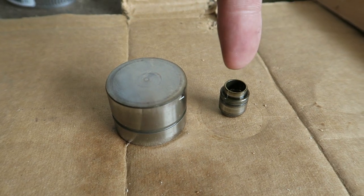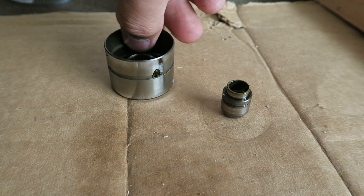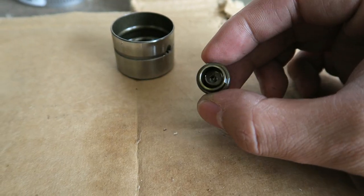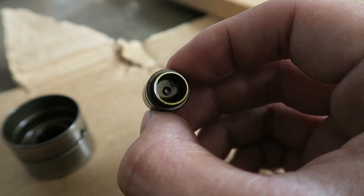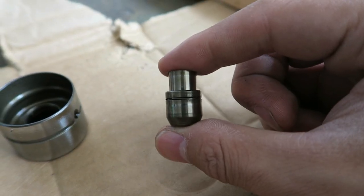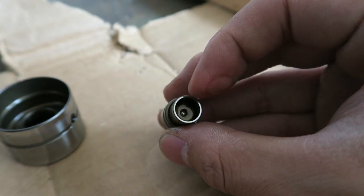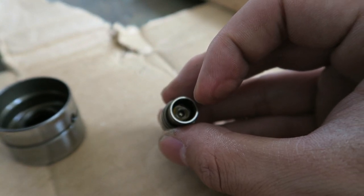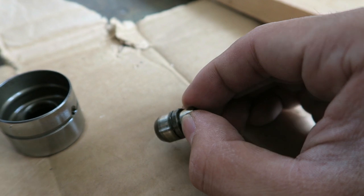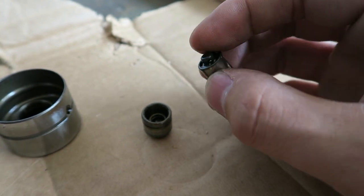Alrighty, so as you can see right there, that is the actual piston inside the lifter. And after I flip this over, now you can see the empty casing. Oil comes in through this passageway, enters out into this channel right here, and then fills this piston right here. The reason why this piston causes a ticking noise is because if you can see in the center of this middle piston, there is a ball and spring check valve. If the piston can go freely and you can squeeze it and it bounces, chances are either the ball and spring area has to be cleaned out, or the spring has failed and all you're feeling is the air pressure on the inside. If I pull this apart, you'll clearly see that there is a spring assembly right here and a check ball valve.